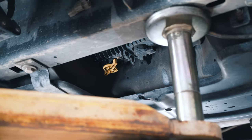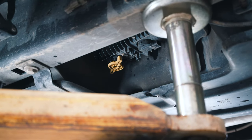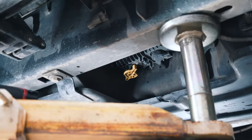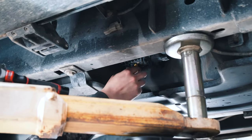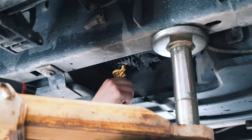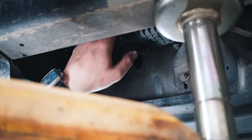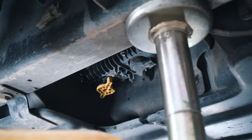On the earlier versions, if you took the drain loose it would just keep draining and pull a siphon from your fuel tank. So what I like to do is open this drain up and then take these bolts out, which will drop it down — and it'll usually stop draining after that.